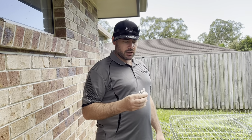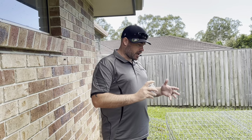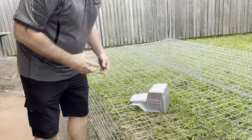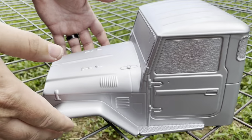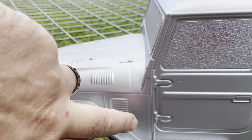So the first coat of the primary color, in this case, is going to be racing green. We are again gonna do the dust coat first. If you wanna come in and have a close look, you can now start to see that we've put a lot of paint on. When you're looking straight down on the body, we're starting to lose that grill and we're starting to lose this little panel here.